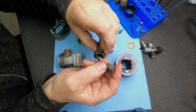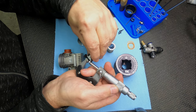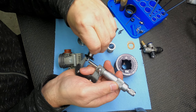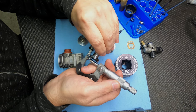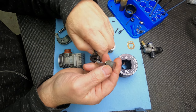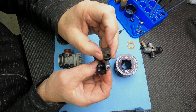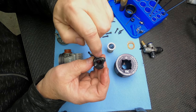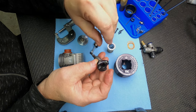You're always going to have a little movement - there has to be clearance for oil. If you had it too tight, there wouldn't be enough room for oil in there. What I do when I rebuild an engine is use a micrometer and measure a few places all the way around. You can see it's about a half thousandths lower on that side - they wear unevenly. When your engine is spinning, you have your explosion at the top of the stroke, it pushes the piston and rod down and spins the crank. So your wear will be on the top of the rod bushing and the thrust side on the piston pin.